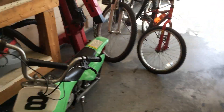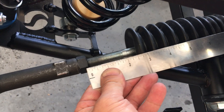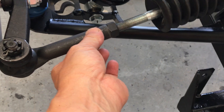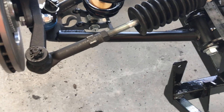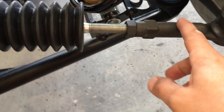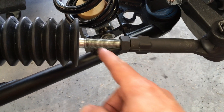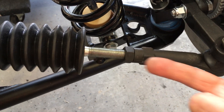I initially picked about a two-inch measurement and threaded the nut on, but the tie rods were sticking way too far out — I couldn't get them in. I had them bottomed out, wrenching as hard as I could. What I discovered is that the threads inside here were really wonky. I had to take a long bolt and ram it in to clean off the threads, and after that I gained about an inch and a half of clearance.